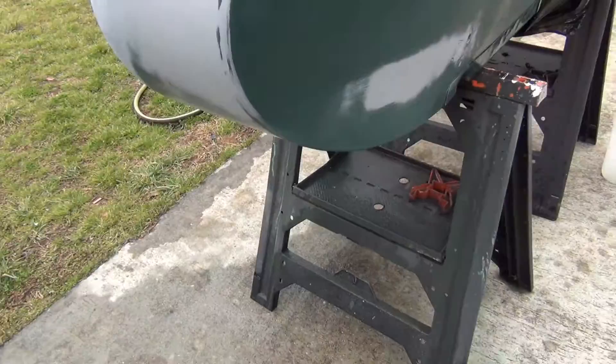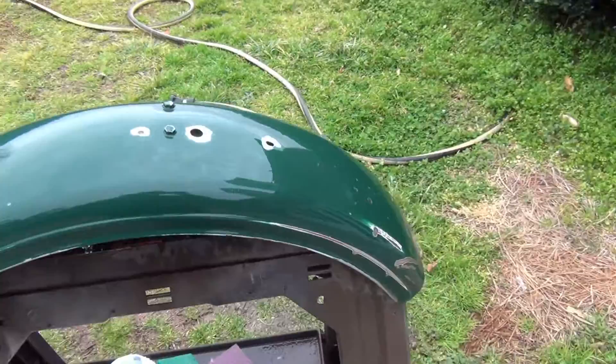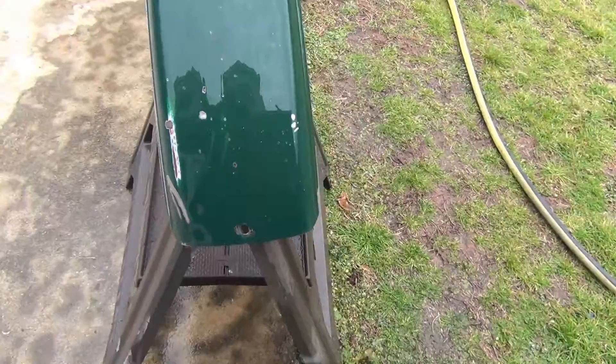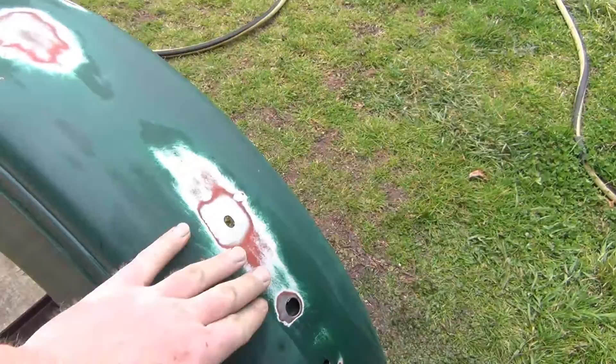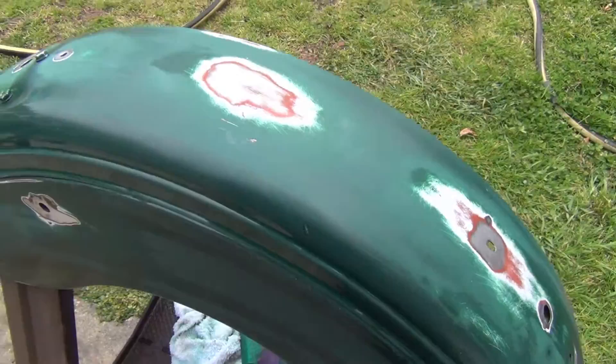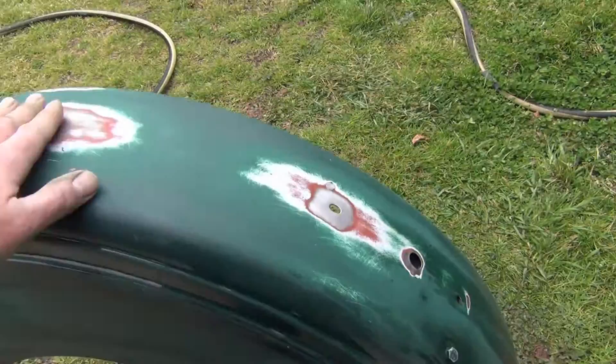I'm making a little bit of progress — I've been sanding by hand, started with 80 grit and went to 100, working our way down. Still got a lot to do up here; you can still feel all this. We've smoothed out a little bit of primer with a light sanding. I sanded it down and you can't feel the transitions anymore except in a few small areas. I'll touch those up, get some priming done, then go to finer grit sandpapers and keep sanding until it's smooth and ready to paint.